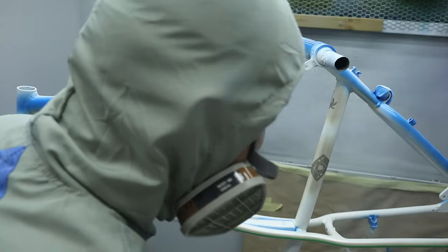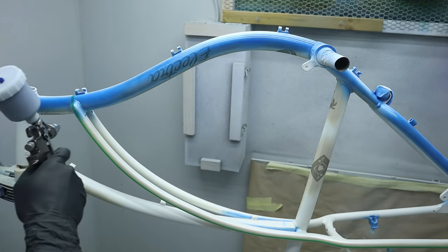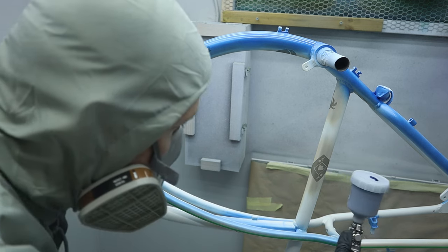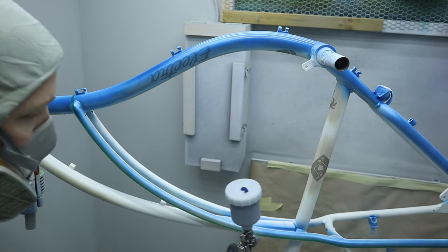Because of the semi-transparent paint, the color you spray it onto will give different looks depending on what color your primer has. So do your research and if needed lay down a base coat with another color than your primer before you spray your metallic.